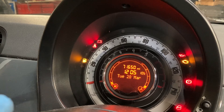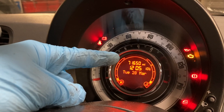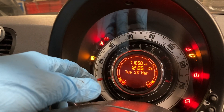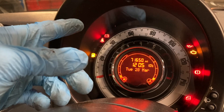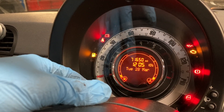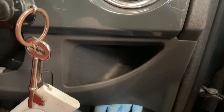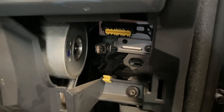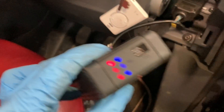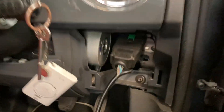Here we are — we've done a quick module installation. Interesting to note: I'm about to try and do a proxy alignment, and just by plugging in that module, the mileage has stopped flashing. I'm still going to go through the proxy alignment to make sure everything is recognised, but that is a really good sign that this job has been a success. Fiat use the mileage flashing as a general indicator for electrical faults. If you're going to try and do this at home yourself, you'll need an OBD tool — goes into the OBD2 port right there. We're going to quickly load up the software and do a proxy alignment.